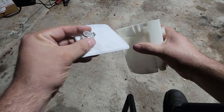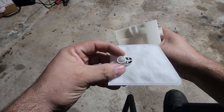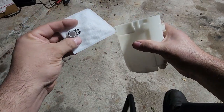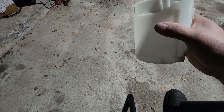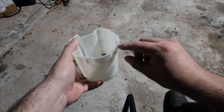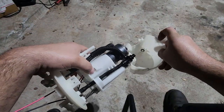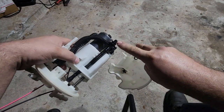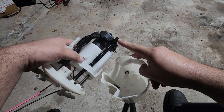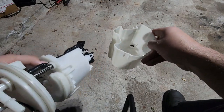I'm just not comfortable with how small those openings are inside there, with this plastic piece being jammed up completely against it. It could definitely cavitate. It can do some weird stuff. Definitely cause fuel pressure issues if you do that. And the other part of trimming these here is you are letting this port, you are letting this piece right here come up off that O-ring about the same amount. So probably like half of it. It probably still works, but it definitely would be worrisome of it not pulling fuel from one side of the tank into the housing here and keeping it filled.